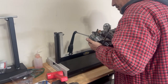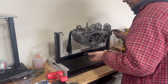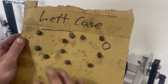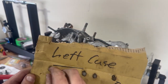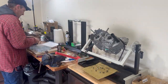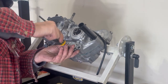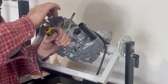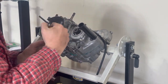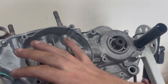We're going to go ahead and put the motor in the motor stand to give us a little better access at putting stuff back together. We're working on the left case, so we're going to use our left case bolt pad and try to exchange these for new bolts. We've replaced all the bolts and we're just going to hand snug them down, then go over with a ratchet and just tighten them up. There are no torque specs, and we do not want to strip the case and end up with an issue like this bike already had.